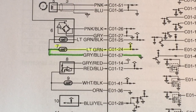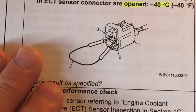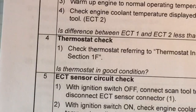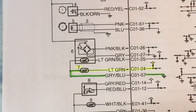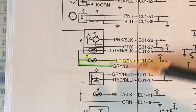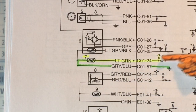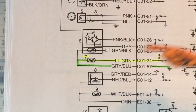Why am I interested in looking at this? Because of this testing procedure detailed in the manual — it shows a dead short across the connector of the engine coolant temp sensor itself, and it always leaves me wondering: how do you short something out without actually smoking the module if it's a dead short?